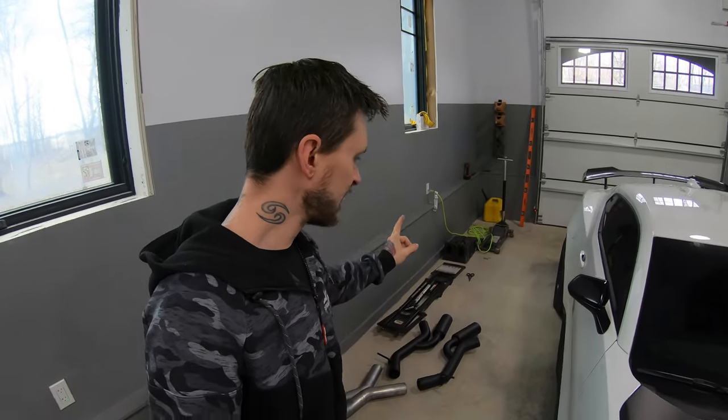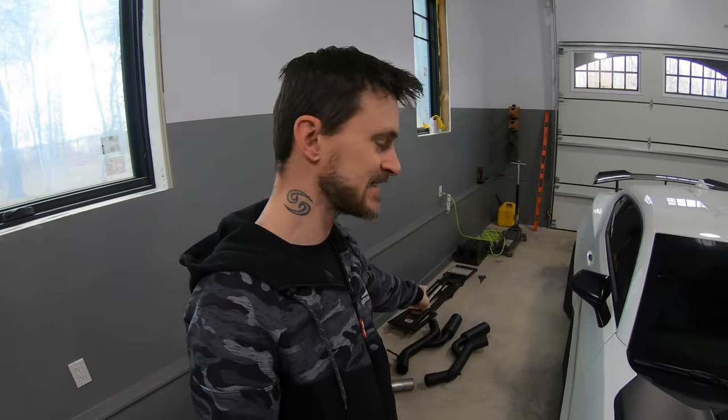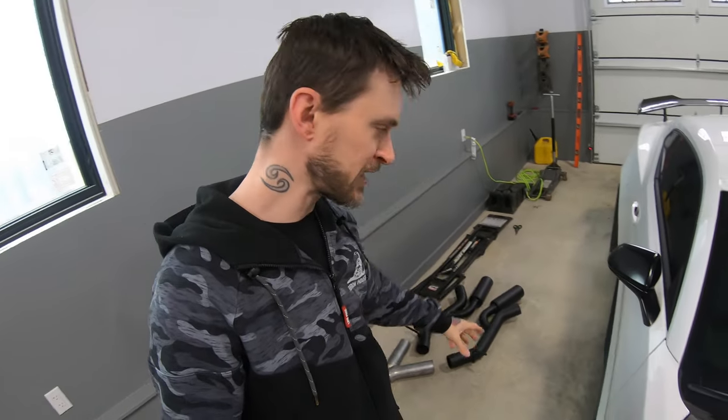With a Helmholtz added into an exhaust system, and there are online calculators for this, if you have a drone at certain RPM, say 2,500 RPM to 2,900 RPM, and that's where your drone is at its worst, if you go online and look at a Helmholtz calculator, it will calculate the size of the pipe you need, the diameter, and the length that you need. And you don't have to make it out of a bottle like that. You can make it just out of like a 2-inch piece of pipe. But if you do all 2-inch pipe, you're gonna have to make it much longer than what you'll actually need. So again, let's say the calculator says you have this horrible drone, it sounds terrible, your head's gonna explode from 2,500 to 2,900 RPM. Add a 2-inch piece of pipe, 28 inches long, block it off, and that'll stop your drone.